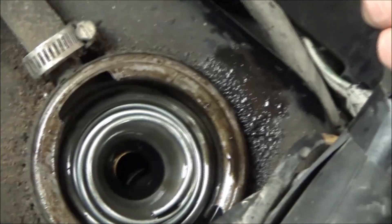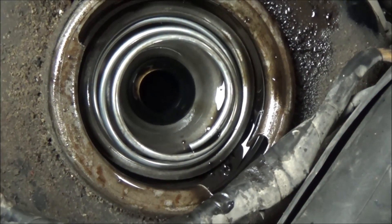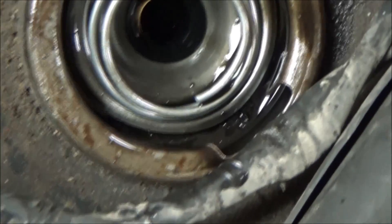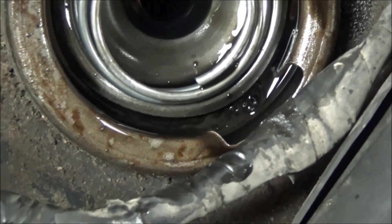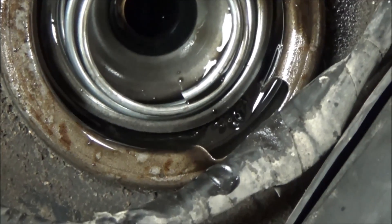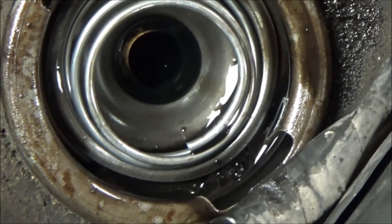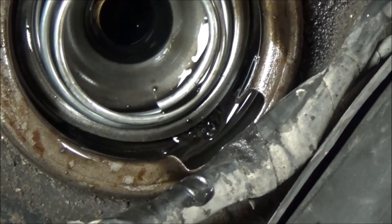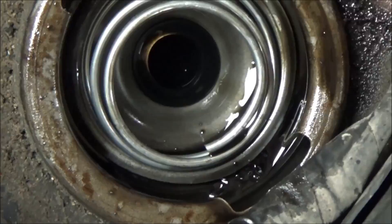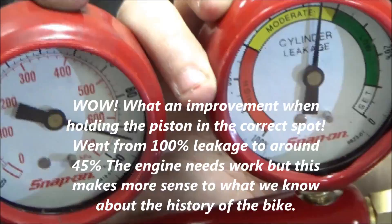Come in and get on the oil tank. Put some air to it and we'll see. It's a good idea to apply your air pressure slow and not just dump 100 PSI in one shot. There it's bubbling — keep going. I'm holding it pretty easy here with the brake — it's only like a thousand times easier. Look at how much better it's getting being able to hold it. Read that gauge — get a light on that. Take the air away.